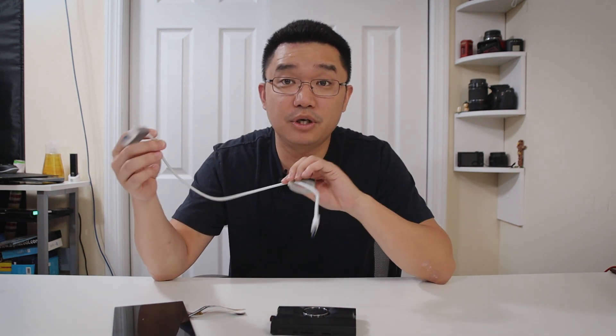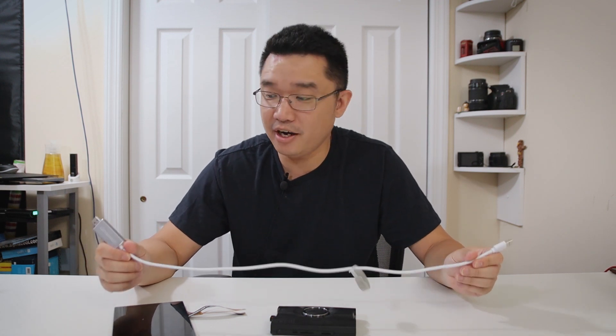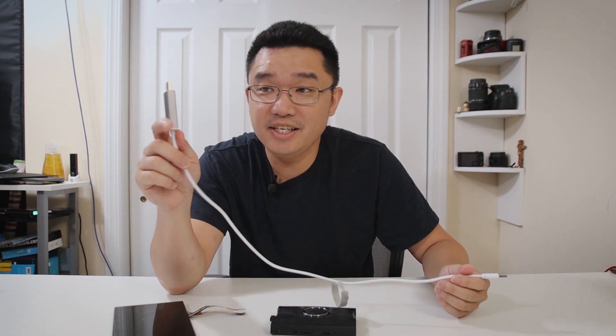All the products I talked about are linked in the description below. The streaming cable actually works for multiple computers — not just LattePanda — it works from a Raspberry Pi to your desktop or any computer. It's essentially a USB network cable. One installation tip: the larger end goes to your desktop as the client, and the smaller end is the server. I had that mixed up and had some trouble, but once you know that, setup is straightforward — install the DHCP server on the LattePanda side. If you have questions hit up the comments, consider subscribing and hitting the bell notification, and as I say in my nerd cave: hack till it hurts.